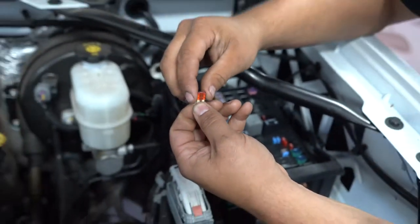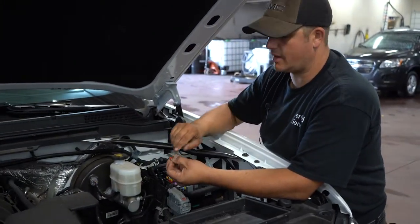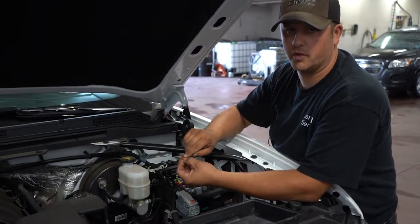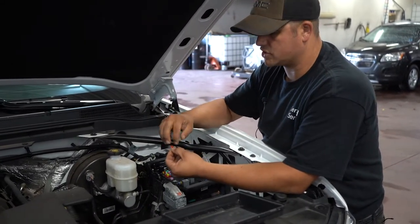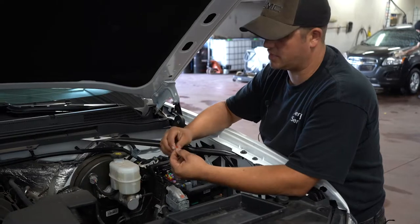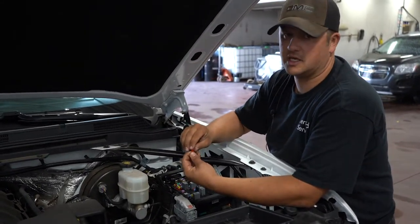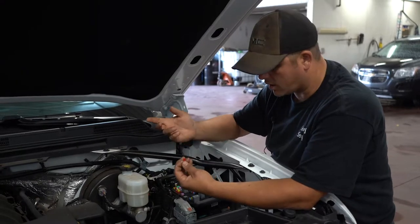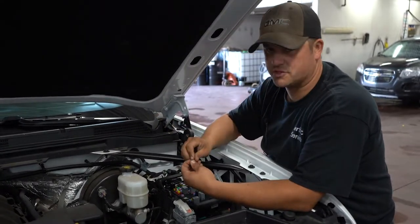You can take them out and look at them visually, but those fuses don't necessarily just blow in the middle — sometimes they'll blow on the sides and it's really hard to see. Some have a darker plastic so you can't see through them even holding them to the light. Really, using a test light is the best thing to do. Or if you've got a spare fuse, just put it in and see if your circuit starts to work.